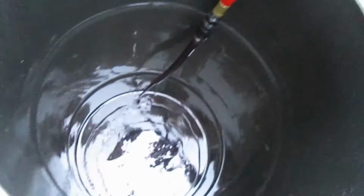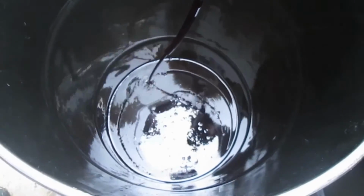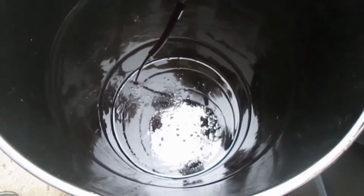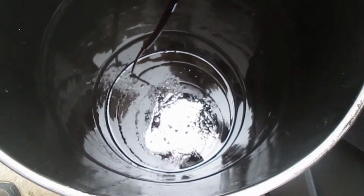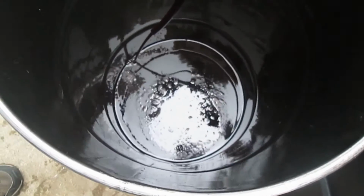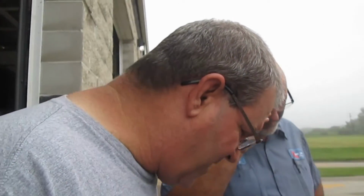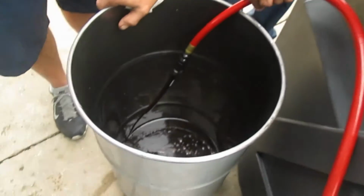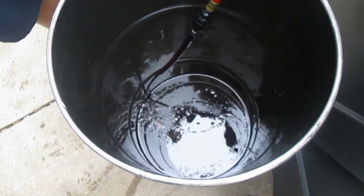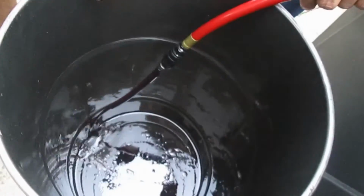Now, can you imagine you're at 90-some thousand miles? Can you imagine going 150,000 miles on that? There's a good chance that you could fry your transmission by allowing it to go beyond this point. It wasn't feeling like it was shifting like I wanted it to. I was having to give it more gas to make it shift. Overall, that definitely needed to be changed. I'll probably have to bring the other 2011 in and have it done here in the near future.